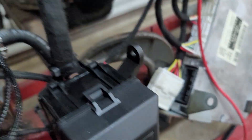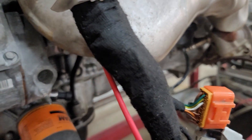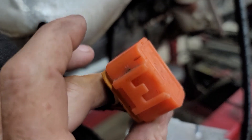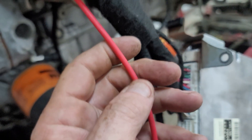Running through here now — this being a GS400 harness, your ECU sits in the engine bay. You've got a grommet there to keep your computer sealed from the elements as best as you can. Running down, you've got a bridge terminal — ignore that, leave it, don't unplug it. You've got a 10-gauge cable coming out which is your main power supply for the system; that goes directly to your battery positive.